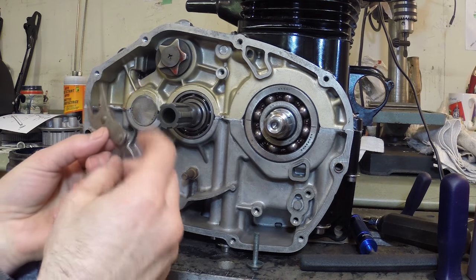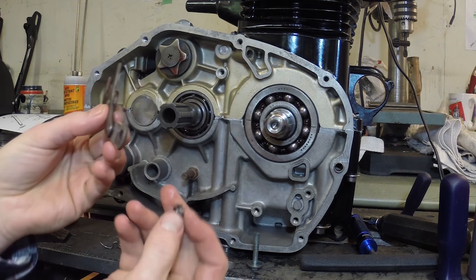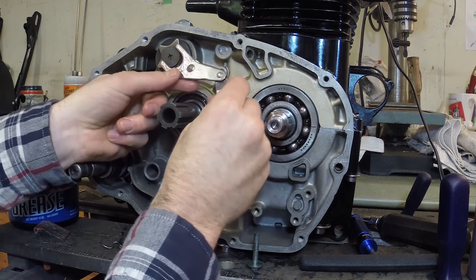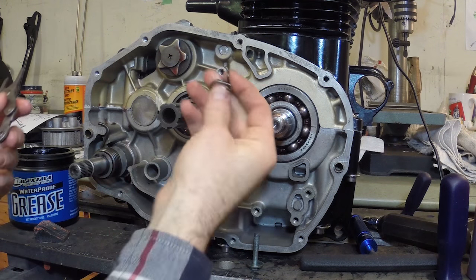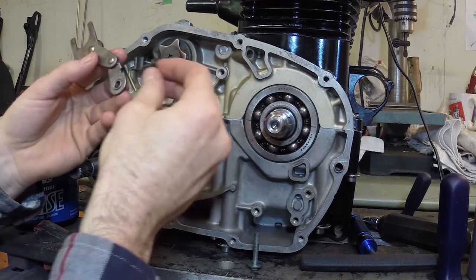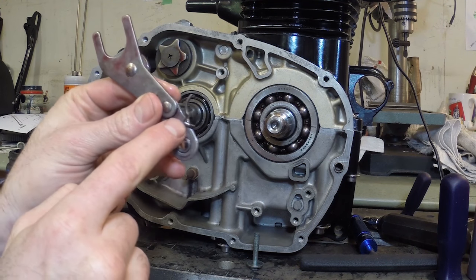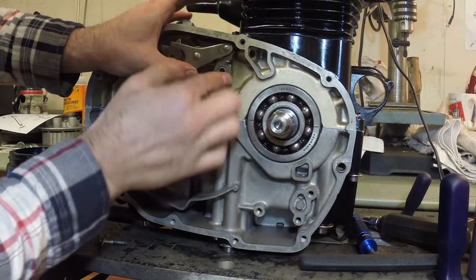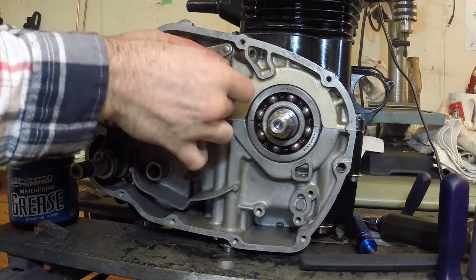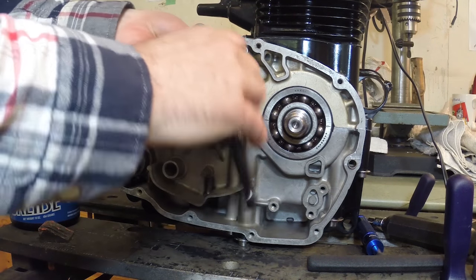I have this little mechanism here that just fits on to the end of the shift cam — it goes in there with that round thing at the back. There's a little tiny piece that fits on the back of this; I've greased it up a bit so it'll stick. Then this lays in there, and there's a little spring that goes in with the longer arm at the back. You kind of have to do all this together — the spring in, greased threads, and the bolt. So we have everything in place: the spring, the washer, and the 10mm bolt.